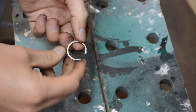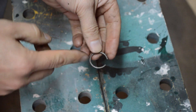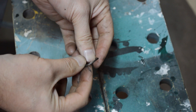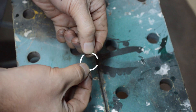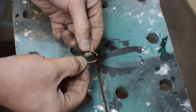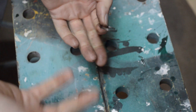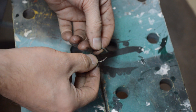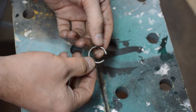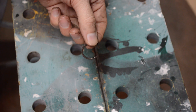Incidentally, if you really don't want to go through the trouble, these circlips are probably not that expensive — a couple of bucks. The thought I had is: why not just cut this in half and measure it with a caliper to the thousandth — how thick is it exactly? You can put the pieces in, and when you get your new circlip, just measure it and make sure the new one is the same width. The new circlip may be a little different, and if it is, you could have ordered the wrong parts, but it should be pretty close.